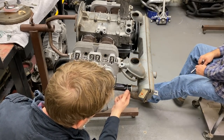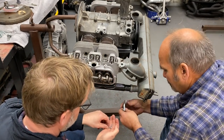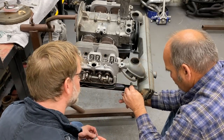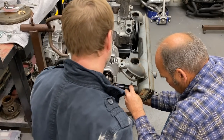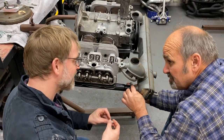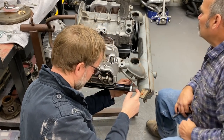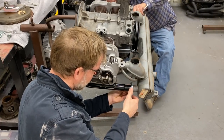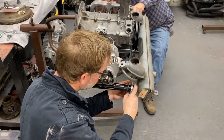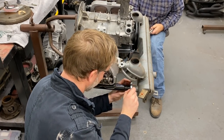Forks are good on the nut side. All right, so we got this little. Yep, basically, I'm going to show you how it goes. And then pull this like this. And you want to place your clamp like so. You want to capture that metal piece and this lip on the muffler. Yep. I'm going to bring that over. Like that, and you want to make sure, in case Scooter's watching, that these are straight and the bolts are symmetrical, not tightened on one side. Gotcha. Equal length. Let's tighten them up. I'll give you my tools when I'm done. You should be ready to tighten yours up.